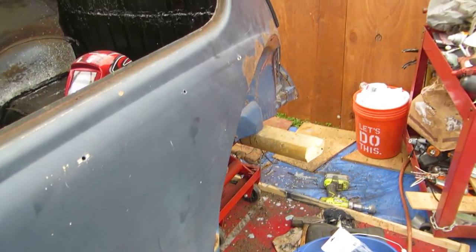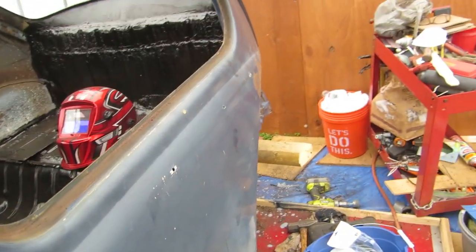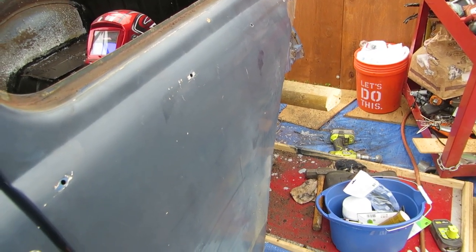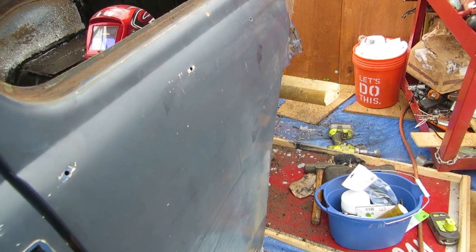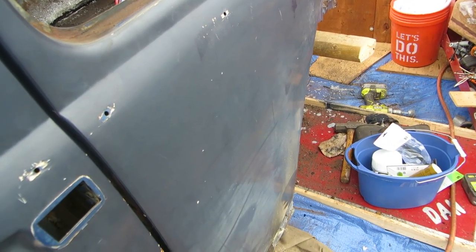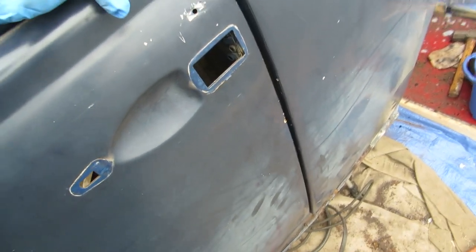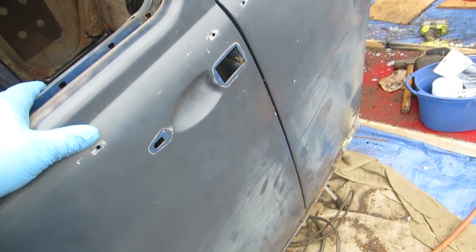Now, why do you want to do this early in the game? Well, here's the deal. If you paint it white, then you can tape it up because everything else is going to get blue. If you paint the car all white and then you clear this, you can't clear the other white until you spray it, and you can't tape this up until the clear on it cures really well, or you'll peel it up and you'll end up with problems.